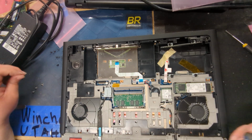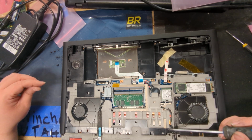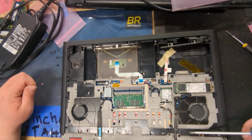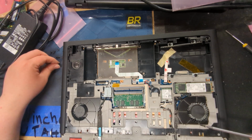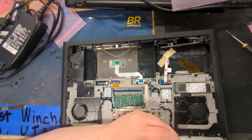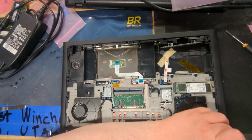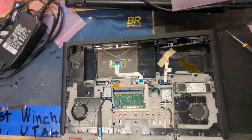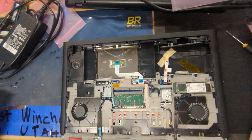So one thing that is nice, this is upside down, but this is M2.5 by 8, and these ones are, you know, 2 by 3, M2.5 by 5. So you can tell just by the length, that one's longer, so clearly it's got to be this one. I do like that they do label these from time to time. Sometimes they forget, sometimes it is actually really helpful because it gives you a good indication of the layer